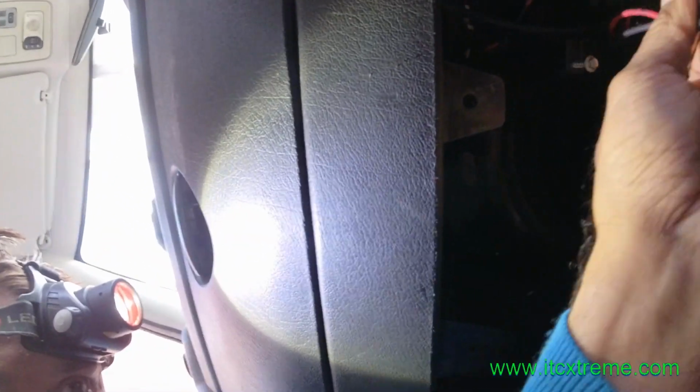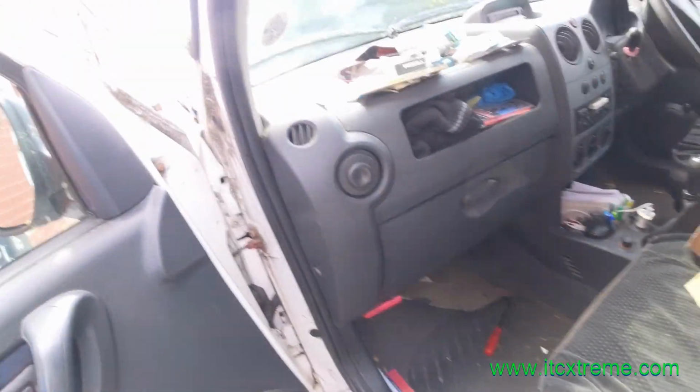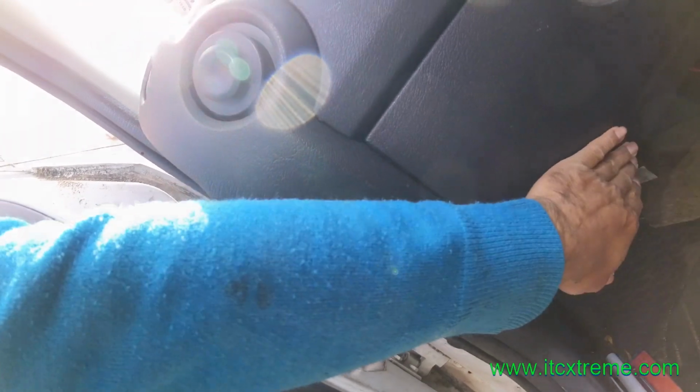We were messing around with it to try and establish what had gone on. You've seen the state of the actual resistor pack. That's the fan connector. So we're just going to be reversing the process by taking everything off. At least you know that in the UK, if it's a right-hand drive, the resistor pack is situated under the footwell, right next to the fan.